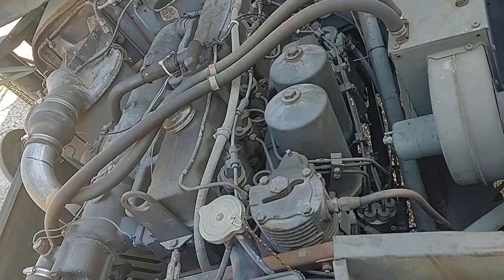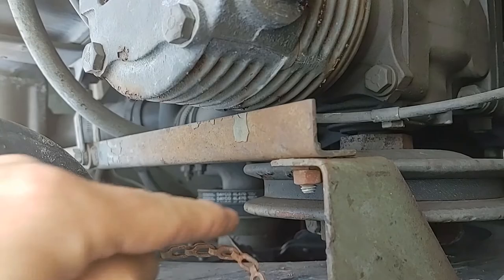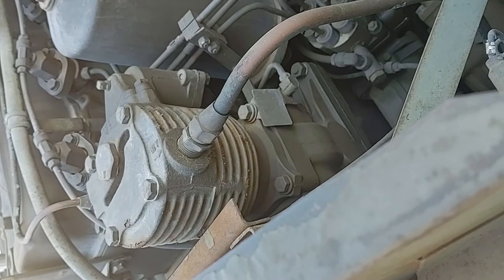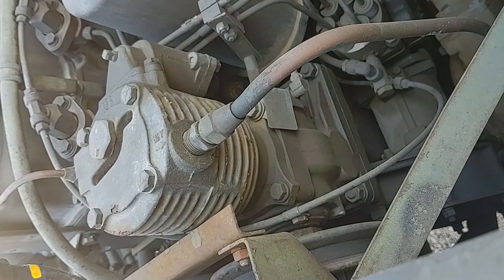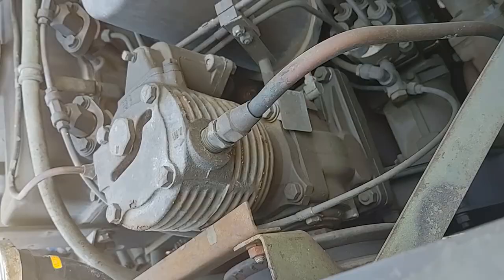Here in the engine compartment, zooming in to the air compressor — this is an air pump driven by the fan belt connected to the engine's crankshaft. The air pump is used for many things on this truck: it stores air in a tank, which is used for power-assisted brakes, windshield wiper power, trailer brakes if applicable, shifting the transfer case into six-wheel drive, and operating the dual air horns.